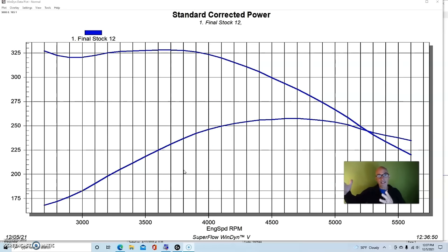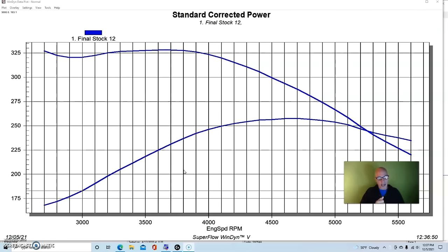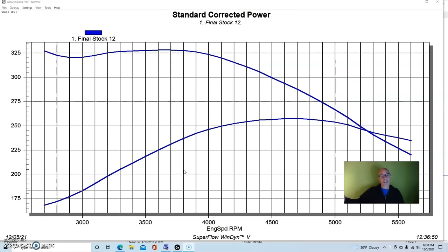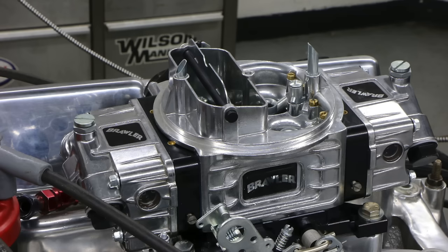The Explorer motor already has a good intake manifold — a cast version of the cobra-style tubular intake that works very well for fuel injection — and GT40 heads, which are way better than the factory E7TE heads. If you start with that motor, put springs in it, add a cam, and swap the intake if you want dual-plane carb setup, you'd be well on your way. It won't match the Blueprint heads we ran, but it's much cheaper since you already have almost everything you need.